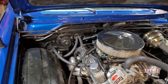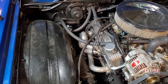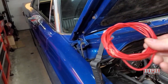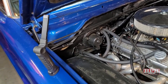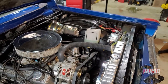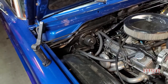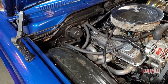On most cars, most of the older cars at least, the blower fan will be on the passenger side. But yours may differ, so wherever yours is located, track it down. You'll need just some basic test wire, whatever kind of wire you want, because we're just going to feed direct 12-volt power to the fan and see if it comes on or not. Just get to either your power strip on your car or your battery positive. Find the connection to where the fan connects to the wiring harness and disconnect it, and we'll see if it works.